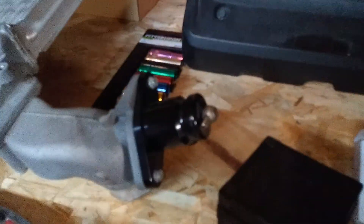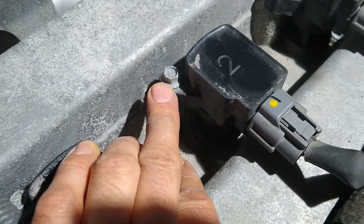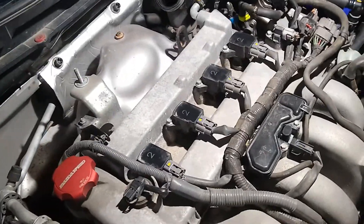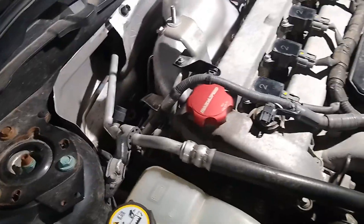Cut that back off — left my Turbosmart BPV on there. Now I'm going to do one at a time. Each one of these has a little 8mm screw that holds the coil-on-plug. I'll go down through here, unscrew them, do each one at a time, and take a look at the stock plugs. These are a step colder than stock, so if I pull them out and they're the same kind, that means someone already replaced them. That's part of having a used car, especially one that people modify — you don't know what's already in there.